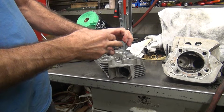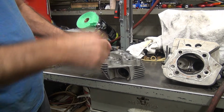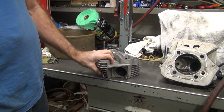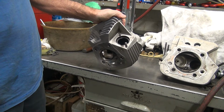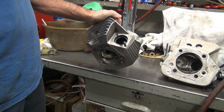That means the broken off stud is all curled around the tap right now, so now the whole thing is jammed up. You can't unscrew it because the hole will be like this. Figure eight. Yeah. So you ain't turning that out of that hole. I have a tool that goes in there and unscrews taps. Yeah. But that would not unscrew. That would have to be burned out.